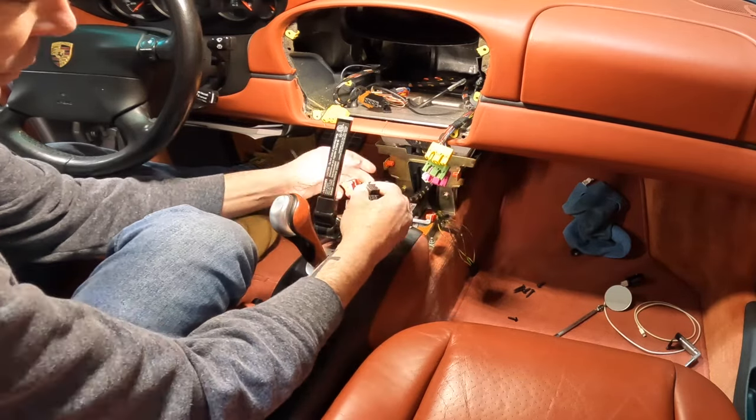Last thing, in pretty much all the cars, and we talked about this with this piece here as well as the mounting shroud here. This is basically a cable that says, hey, something's been stolen. So if you break that contact, I've seen this a couple different ways, so we're going to try it the way it says in the Porsche directions. They say just to tape this off. It's pretty well insulated already, so I don't think we're going to have any problems, but we'll go ahead and tape this off just so we don't have any problems and kind of stick it back here.